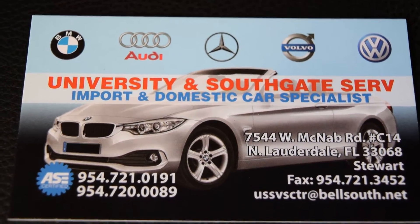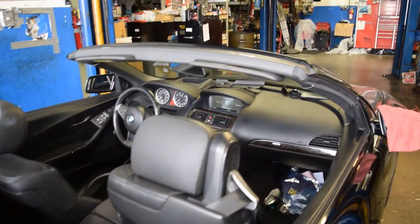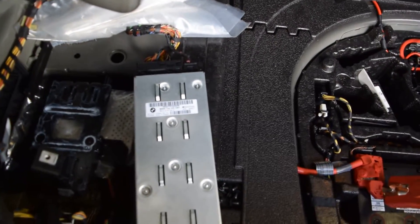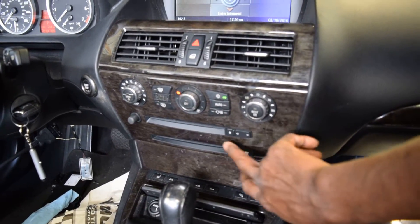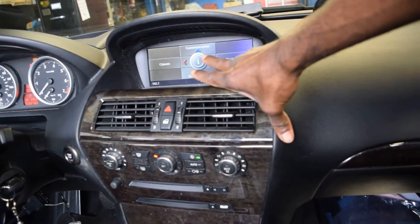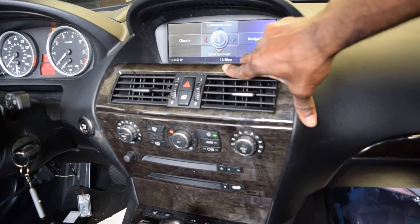When these guys have BMW issues they can't solve, they call me. This car project — the car was not putting out any sound, so I troubleshot the car communication computer, which was one of the issues, or it could have been caused by the top HiFi amplifier. We replaced both the amplifier and the car communication computer, which is this unit here with the DVD navigation and CDs. The iDrive navigation CD has to be installed on the hard drive inside for navigation to work. I don't know if the owner wants navigation enabled — I think he's going to sell the car for around $13,000.